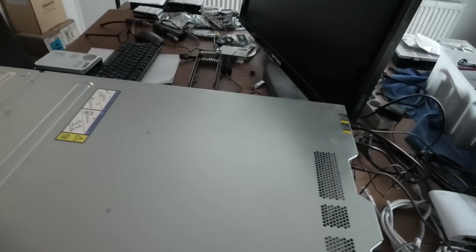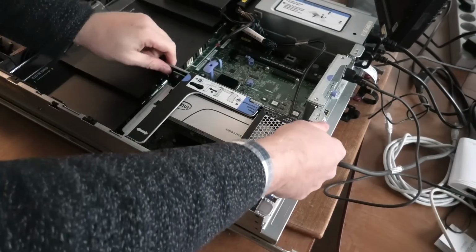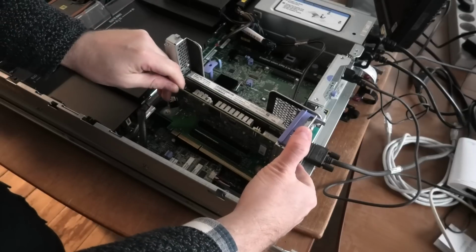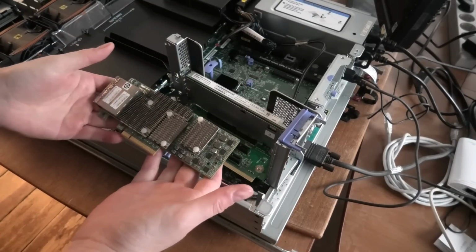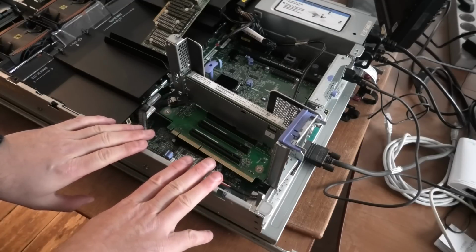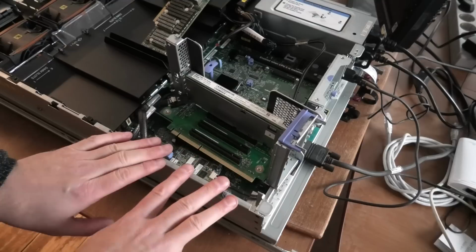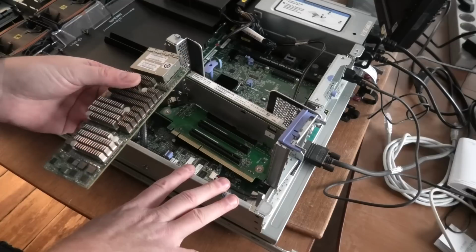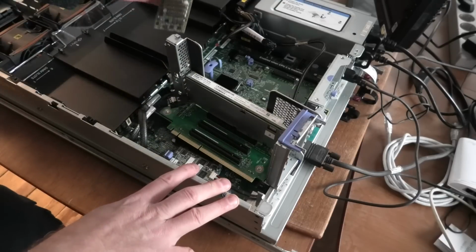Never mind. Okay, let's remove that card in here. It's underneath there. I need both hands. So just to recap, I purchased this nice RAID controller card from money generously donated from my patrons. Thank you very much. So here it is. And it didn't work in the Lenovo Tiny project that I was working on. So we moved it into this, which is a Lenovo/IBM X3650 M4, and I tried to fix the card in Windows and I wasn't able to, so I had to install Linux on this server, and we did that last week, and I managed to fix the card, although I had to reduce the speed of the SAS thing here. But now the ports are enabled, which is a lot better than disabled. So even if it's not running at max speed, I'm gonna test it out.